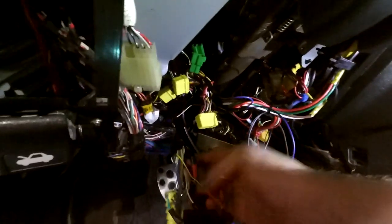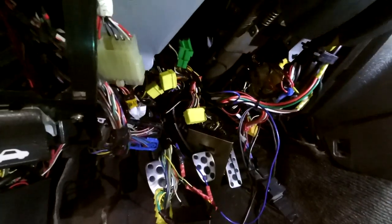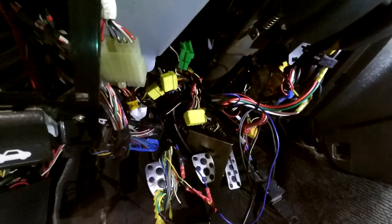Alright, so I just threw the ECU back up in there. We got all the rest of the wiring done. So I just got my power running to this wire right here, and the ground running to the one over here in the corner. There'll be wiring diagrams and exactly which pins go where, and the link in the description from Legacy BBS. So now let's plug it all back in and let's see if it starts.